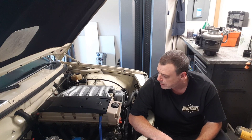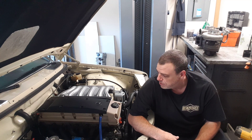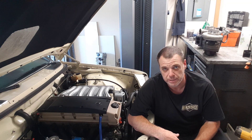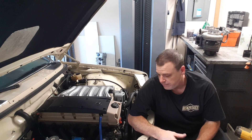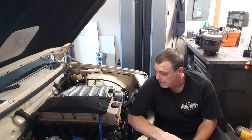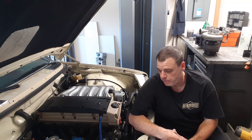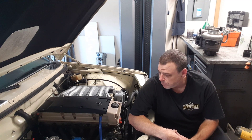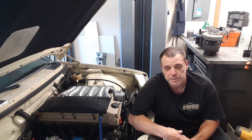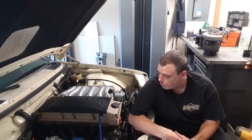We got the stock manifold off, the compounds are out, my downpipe is off, and all the intake tubing is out. When I was putting on the KKD header, I ran into a situation where I couldn't actually fit it in the engine bay. The reason is my engine is now sitting about an inch and a half lower — when I made my mounts, I put it about a half inch off the cross member, to make room for the big turbo with hood clearance. I don't have that constraint anymore, so I'm simply going to modify the mounts and raise the engine up about an inch and a half. I'll still have hood clearance, plenty of room for the turbo, and it should be about back where it was to begin with.